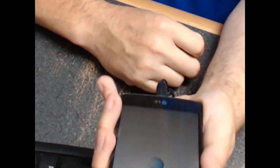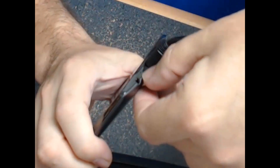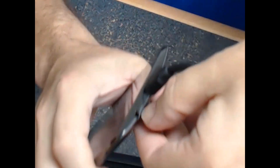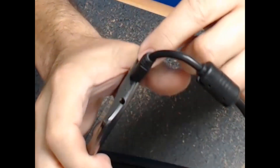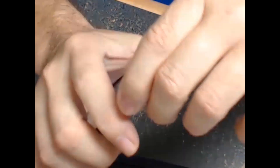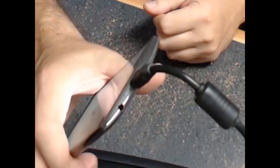It literally took me less than five minutes. The trick mainly is to get your fingernail, a fingernail file, or even a paperclip — something — in one of these little gaps, either at the headphone port or the charging port, and just slowly, gently prise around the edges and you'll feel it snap open. That's all there is to it. Pretty simple, pretty straightforward.